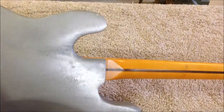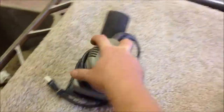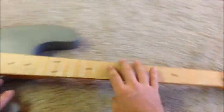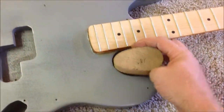Right now it's kind of an embarrassment for whoever owns it. What I'm going to do to get the main amount of paint off the body is use a sander. As the paint starts disappearing, I'll change to a hand block with different grits. As I work around the different curves, I have different blocks I like to use — a rounded one for inside curves, and I always use a flat block on outside curves.